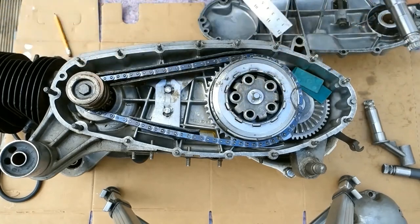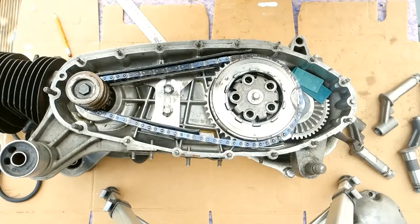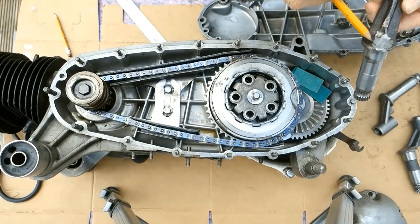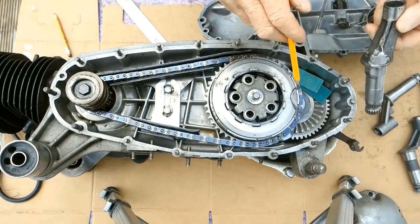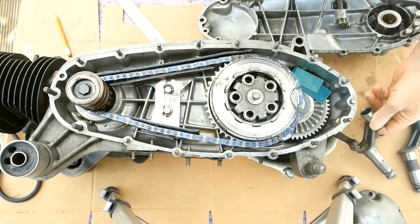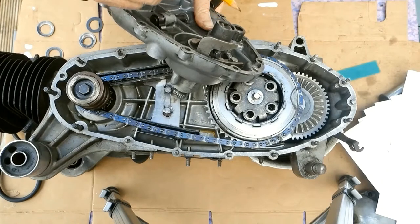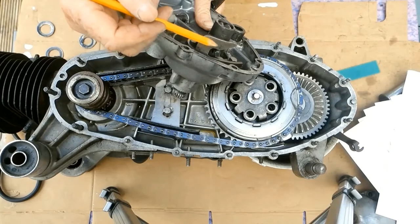I've added 5mm on for the skip. I've done a few dimension checks and I think I've got it within about a mil. I marked the reference pin location and the stop location. Knowing this position helps. I cut the nib off this shaft. GP shafts come with it already removed — I thought it was fouling on the edge. I'm not sure that it was. Looking at it in this position, it might have been OK — it was probably designed to run around the edge of the clutch. There's a reason for everything. From here to here is wasted travel, by the way — the piston does not start rising upwards until the reference pin starts travelling up the ramp. That is why this is the optimum position, on the edge of the ramp.